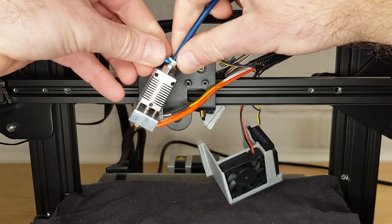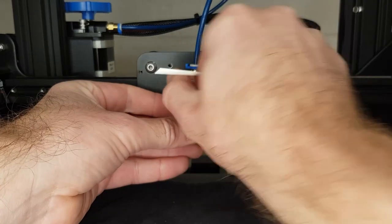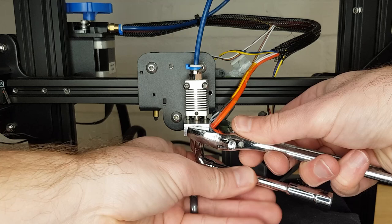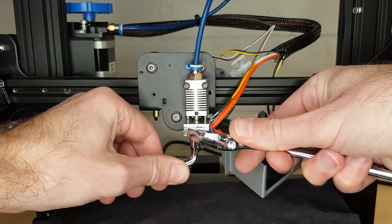Give it a good firm push to make sure it's home. Attach your hot end holding it square while you tighten the bolts. Now tighten that nozzle that final three quarters of a turn — this ensures that the tube is pressed hard up to the back of the nozzle and there's no movement in your Bowden tube, which could cause you issues. If you want a better explanation of this then check out my hot end cleaning and Bowden upgrade videos linked in the description.